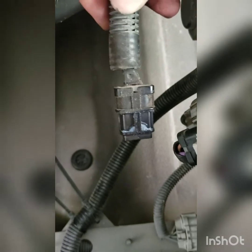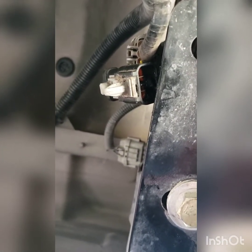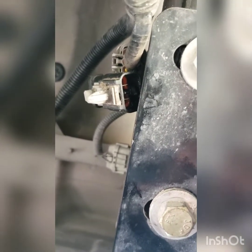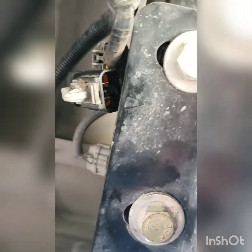This isn't factory — I added my own trailer harness to this 2013 Nissan Frontier Base. After about a year, I noticed while making a 7-way plug to two-wire quick-connect adapter that my Frontier is one of the ones that has the brake controller wire and the 12-volt supply flipped. I'm correcting it on the truck side so if I ever need to replace the harness, I don't have to try to remember to do the swap again.